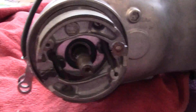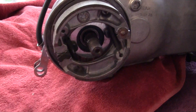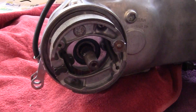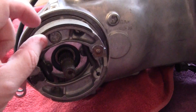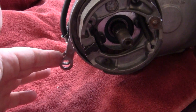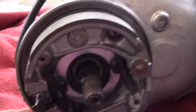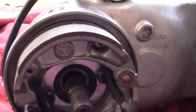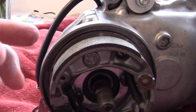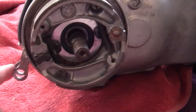Let's discuss how this works for a minute. These are called clamshell brakes. Pretend the wheel is already on here and it's free-spinning — you probably have just a little bit of space around the wheel. When you pull on the brake lever, it pulls the lever towards the front, which expands the clamshell. These pads hit on the moving drum and slow it down.